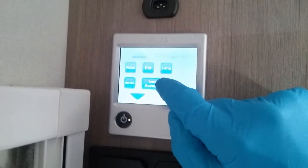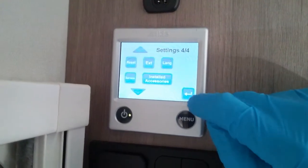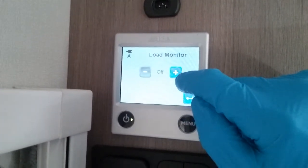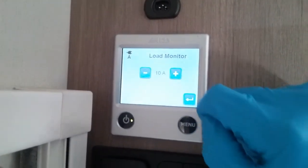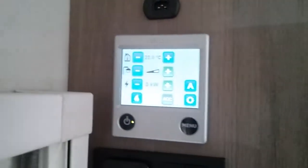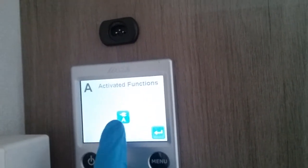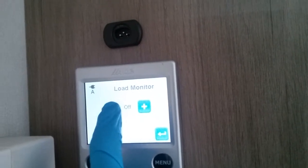We then have installed accessories. I can highlight this one just here and if I go back you'll see I can now access it — this is basically the load monitor. If you know how many amps the site is that you are on, you can pick on here — so let's say we're on a 10 amp site. It now doesn't matter if I ramp it up to three kilowatts because the load monitor will monitor it and avoid tripping. Because it's an activated function, it appears and then I can alter it or turn it back off again just here.